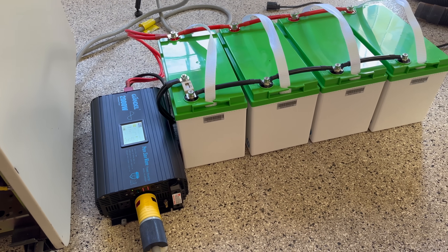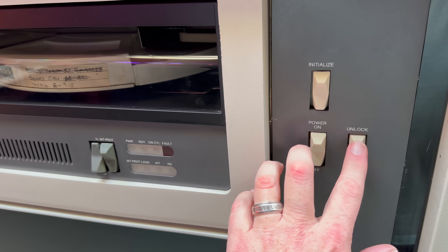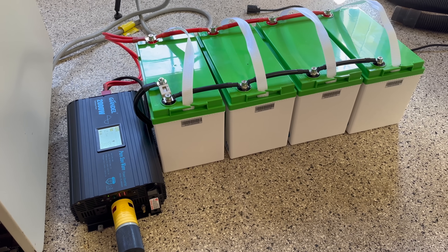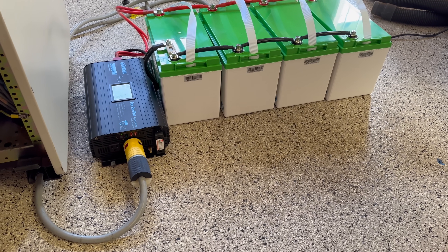When the bank of four batteries was connected, I next connected the bank to the inverter itself. Everything powered up as expected, and I was soon able to plug the PDP-11 into the inverter. The first thing I noticed, however, was a fault light flickering on the PDP-11 power supply — likely a grounding issue of some kind — and this was even before it was turned on. I'm not an AC power guy, so I have no idea how the PDP-11 could actually tell it's being plugged into an inverter rather than line power, but it seemed to know. If you understand why that happened, please explain it in the video comments. In any event, I cycled the breaker on the PDP and the main power on the inverter, and when they both came back up it was without a warning light, so I figured it was time to try. I hit the power button and the machine sprang to life fully on battery power. I have to confess, a few times when I've tried to power the system up, the initial current inrush is more than the inverter can supply — or right on the ragged edge — and about one time in ten it just starts to growl and doesn't actually boot. That worries me a bit, but it didn't cause any harm the couple times it happened.